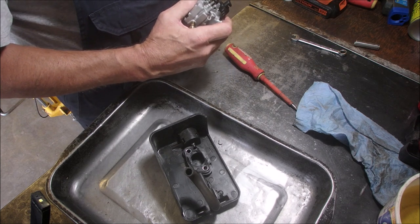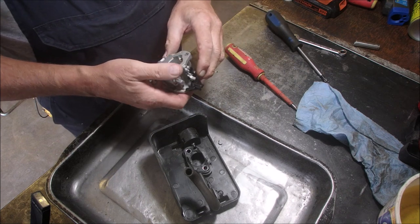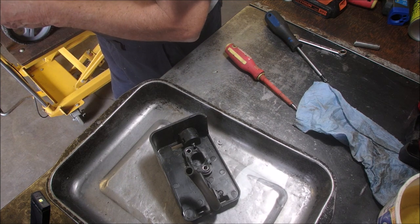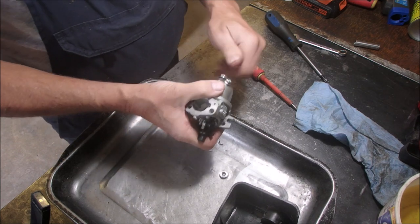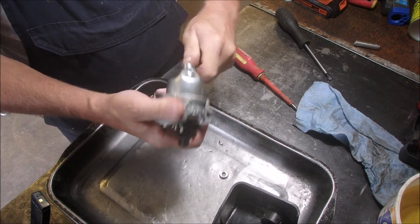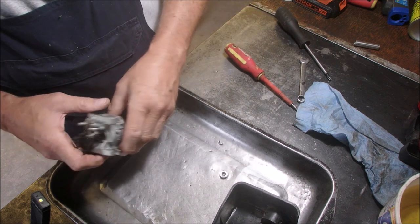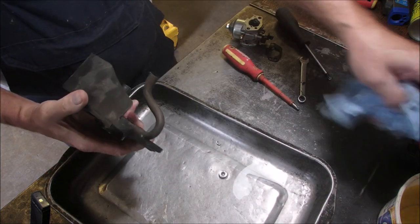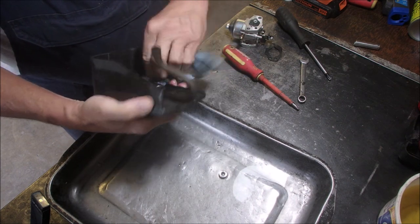The mirror's backwards — there you go right there. Then we take the idler screwdriver holder-downer, which is also known as the idle adjustment pin. There it is, it went in. Two or three threads sticking out the other end. It's funny how everybody copied Honda after a certain period of time. These ones are actually easier than a Honda. Then the bowl and the throttle — bolt it up.